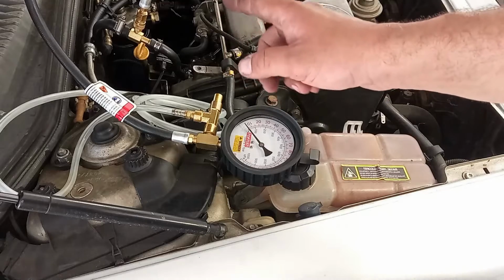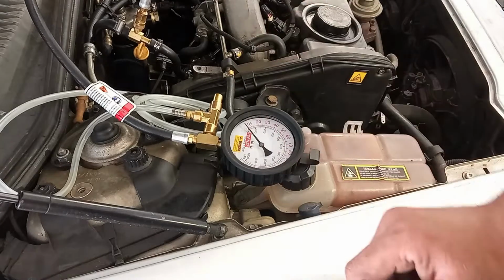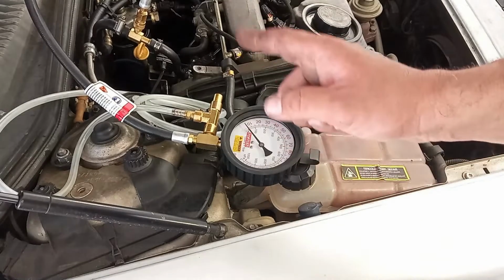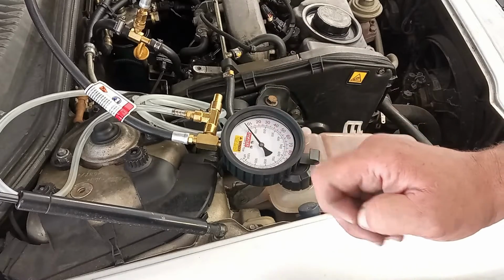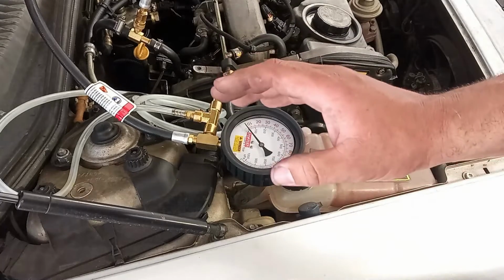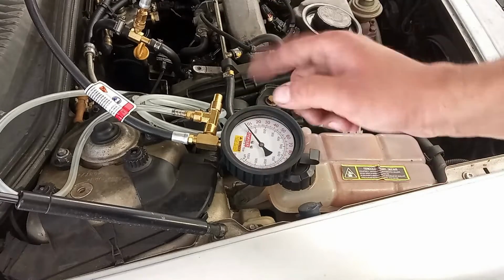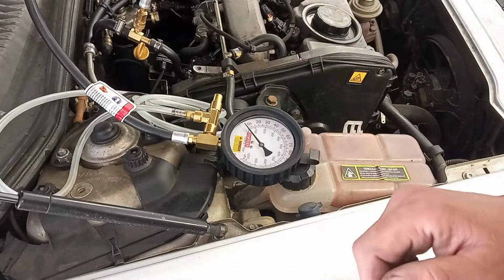And now I may have a problem on the high side of the fuel pressure, so that high pressure fuel pump will come off for sure. I will test again the high pressure side with the diagnosis machine to see the pressure. It is not very easy to see because the numbers are very slow to appear on the screen, but I'm now definitely sure that I do have a problem on the high pressure fuel pump.